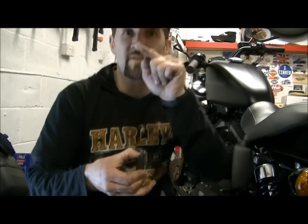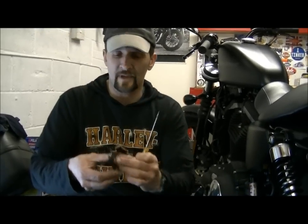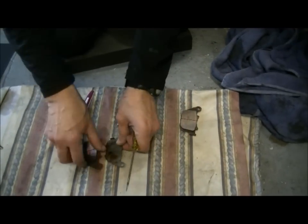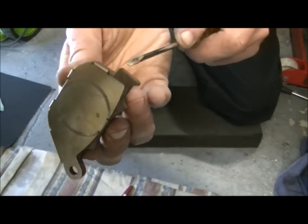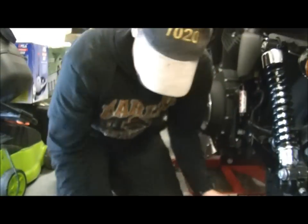It's high frequency vibration. As it stops and starts, you get click click click click click, and eventually it's a singing noise, like a squeal. So these go on the back, they're like a squeal pad, and a great way to deal with them, that's that one, that's the right pad, is to clean them up. They just lift off, they're not screwed on or glued on, they just kind of grab over with all these little corners. So just gently push one end off and they'll ping off like that into Penny's lap. There we go. Right, that's not too bad.